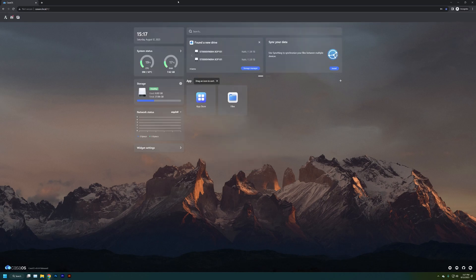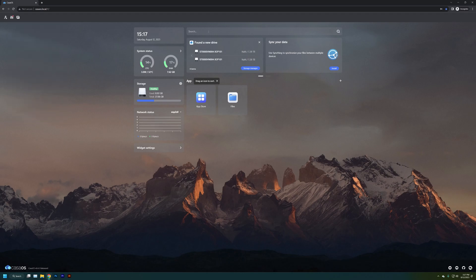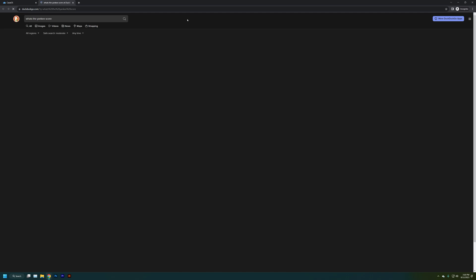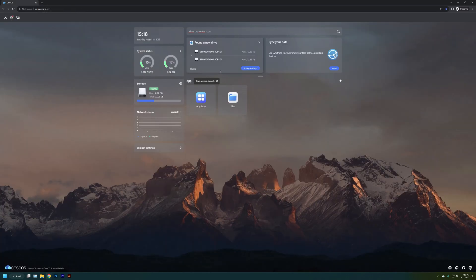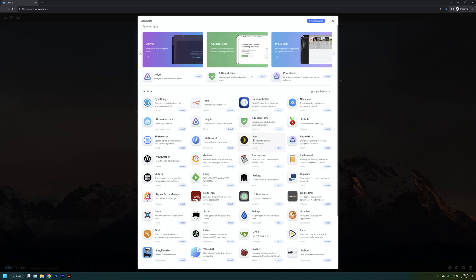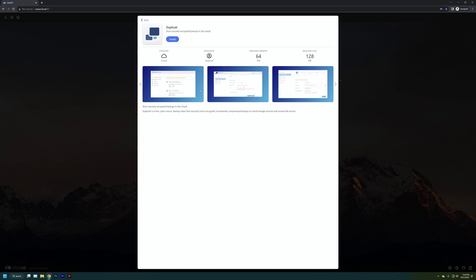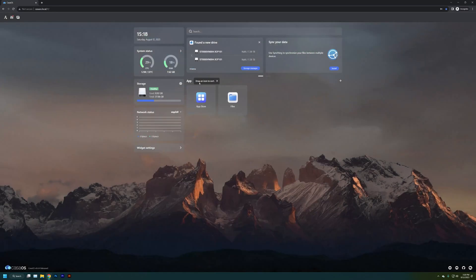Now it's time to set this thing up. What's really cool about the ZimaBoard is it runs a version of Linux called CasaOS that lets you do everything from a web portal. As soon as you hook it up to your network, it enables this browser view to control the entire board. It's got built-in search, and a built-in app store with everything from Samba to Jellyfin, Home Assistant, Nextcloud, Plex — all the apps you've probably heard of for a home server. We're going to take a deeper dive into Duplicati to create backups of our storage to our second drive.